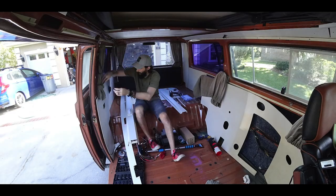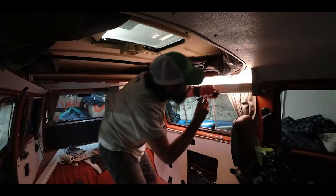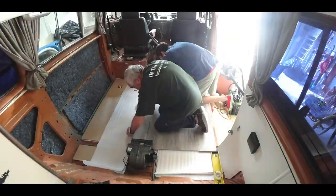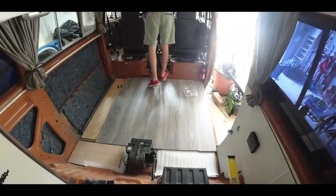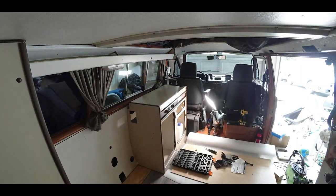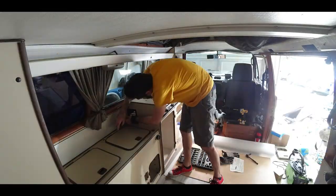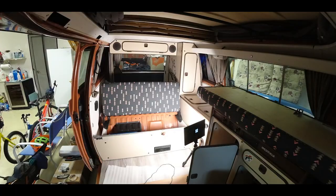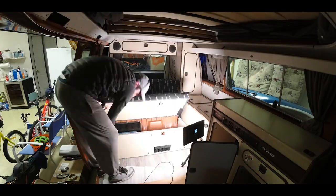I did a lot of maintenance within the van. I took a lot of the roof items off, resealed everything, and packed it up to try to avoid water coming in. In the beginning, I also took the entire inside of the van out, resealed everything, cleaned up all the cabinets, and got rid of the huge propane tank that was half rusting. I'm a little concerned about restoring that entire system, so I'm going to keep it off for now and maybe convert to use a small propane tank. I sealed off all the areas that connect the Westfalia from inside to outside. There was so much rust happening. I haven't addressed all the rust yet — I wanted to take care of mechanical stuff first, and then later I'll deal with the rust on the outside.